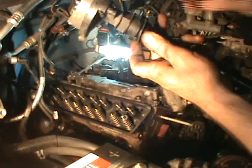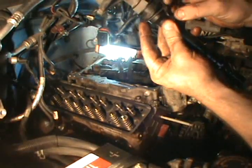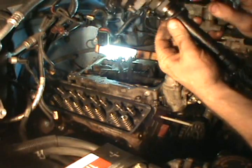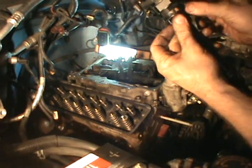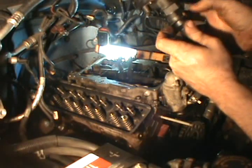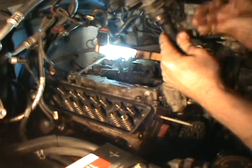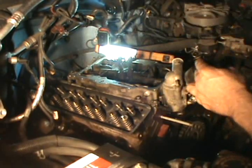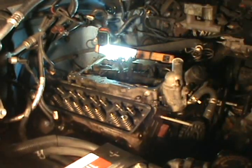You're going to want to make sure you're still on number one. If you're having a problem with this gasket falling off, just take a little dab of grease and put it in a couple different spots. You don't want to glue this one up because you might have to turn it a little bit once we tune it in. I should be able to get it close because I have a scribe mark on there, and then the rest I'll have to set from the computer.